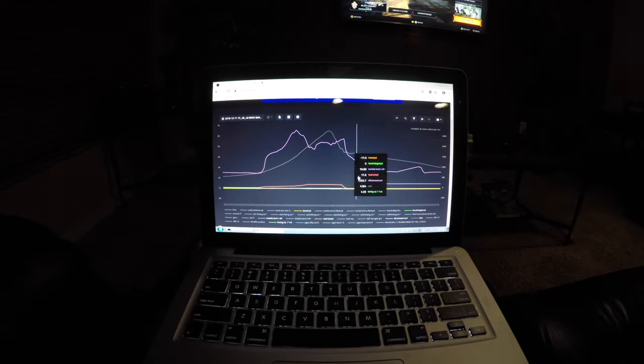So the spool is good. I'm getting full boost at around 3,800 RPM. It could be better, but just the way I've had it tuned, I've got to do some Vanos changes and all that other good stuff, and I don't have time. Most likely on my next turbo setup, I'm going to get it working the way it's supposed to. But yeah, it could spool a whole lot quicker.